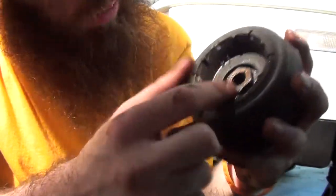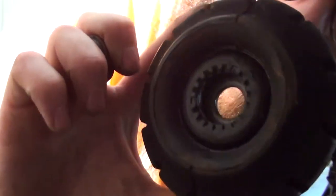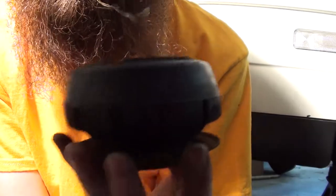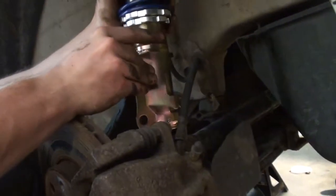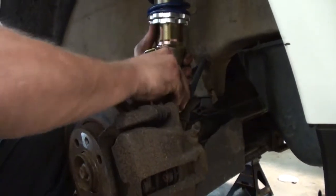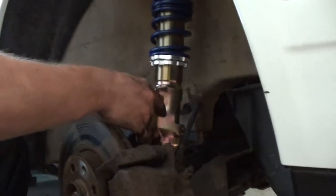Here's the assembly — that's the nut we took off. This big cavity goes up top, and on the underside you can see there's a bearing in here, and it sits like this on the old spring seat. We used the old spring seat on this side because it fits better in the bushing. The eBay ones don't fit really well. So we put the camber bolts back in. The brake plate there doesn't fit in the new assembly, so we're going to zip tie it. You have to set the camber here manually, because you're going to take it to a shop after and align it.